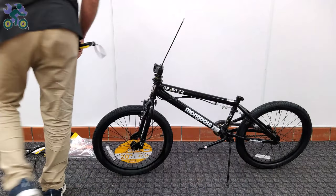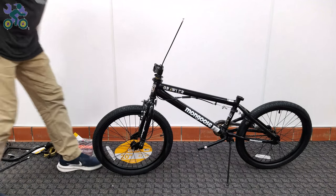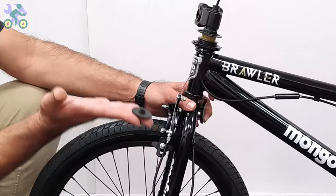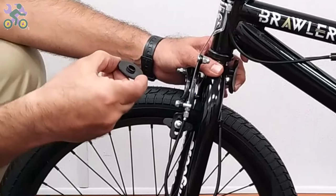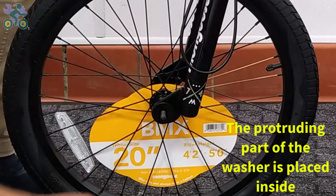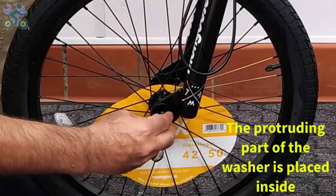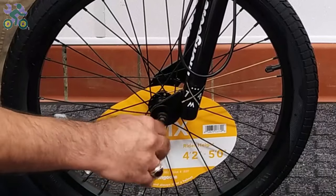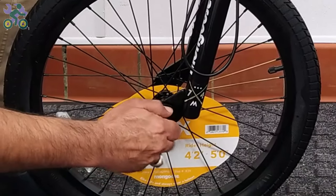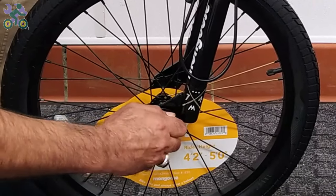You will notice that the bike is stable, although it's best to always keep one hand on the bike just to be sure. There is a hole at the end of the fork. Insert the wheel retainer into the hole and tighten the head nut by hand. In only a few limited models, only washers are used for the wheel retainers. Repeat the same process on the other side.